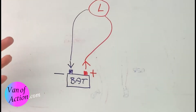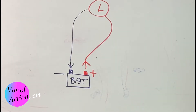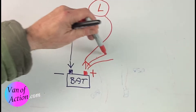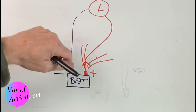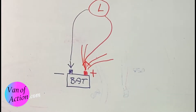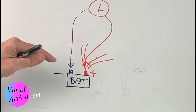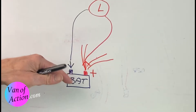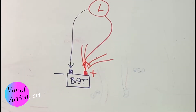Every light, every circuit, every USB port in the van would be wired, in theory, exactly that way. But think about it — if you did that, you'd have a whole bunch of wires coming off that one terminal: one to the USB port, one to another set of lights, one to the cooler, one to the fan. It'd be crazy to have that many wires around that one terminal. The second issue is that wouldn't be safe — there'd be no way to govern or manage how much power was coming out of the battery into each wire, so each wire could become overloaded. So there's a way to handle that: it's the fuse panel.